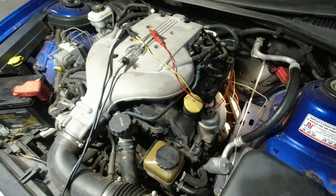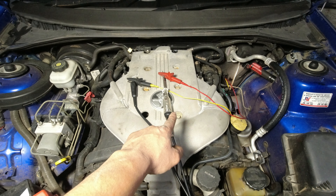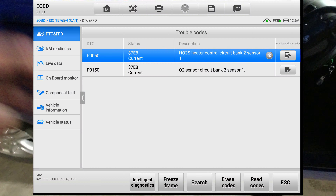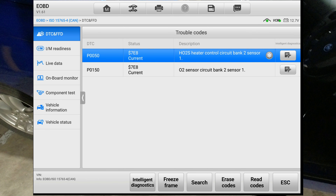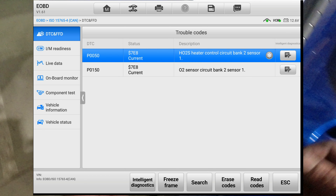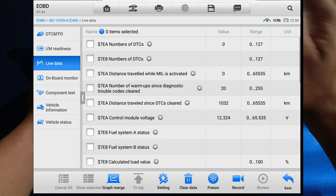Make sure nothing touches on the body. I've got a jumper lead connected to the test light positive and negative. All I'm going to do is watch the scan tool while I start the car. This test is best done when it's cold so you can really see the result. Before starting, I'm going to go to live data on the scan tool and find my short-term fuel trim.